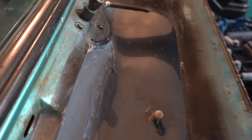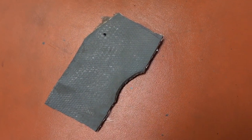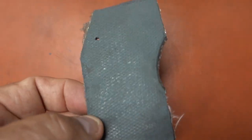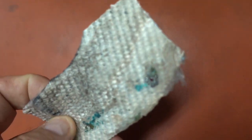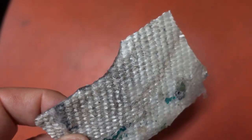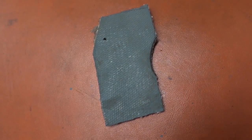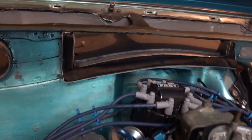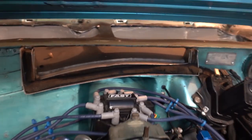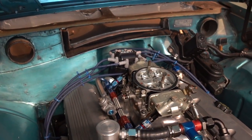It all starts at the cowl. The whole inside of the cowl box is sealed off and it's lined with stuff called cool mat. Here's a little piece of cool mat — it's a great heat barrier. It's silicon, with a rubberized silicon kind of rubber front on it and a silicon material woven backing on it. All silicon. Great heat barrier. The whole box is lined with that on all sides — insulated from the firewall side, from underneath, from the cockpit side. And then that all feeds out here into the engine compartment.